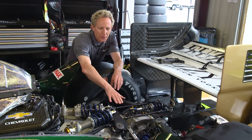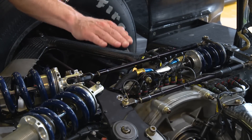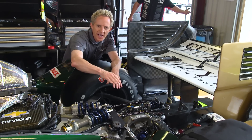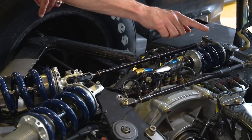It's located here, front and rear, but at the rear it connects the two sides of the suspension together. When the car moves up and down it has no effect, but if it rolls from side to side — in other words, if you press one side of the suspension and release the other — it tries to twist the anti-roll bar.